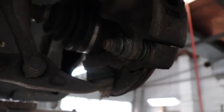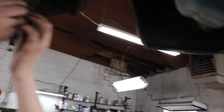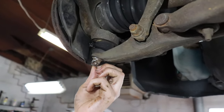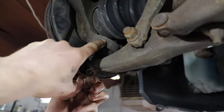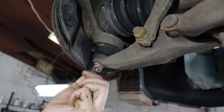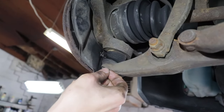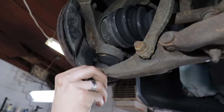So now we're going to do the lower ball joints and the inverted tie rod ends. Pretty simple — bang them out. We will have to get the knuckle off the car because of the way they press up and out. So we're going to have to get it off and get it on the bench so we can actually get them out and get the new ones in.